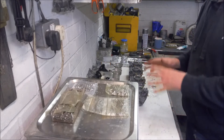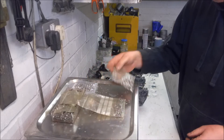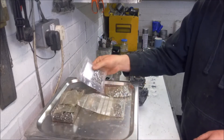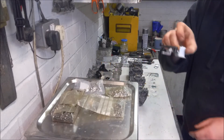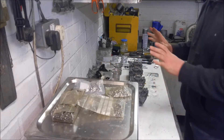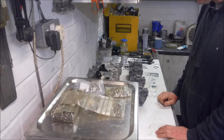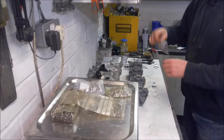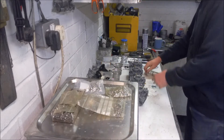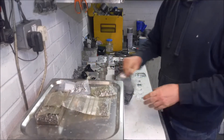I've also splashed out and got myself some nice little stainless Allen bolts - various M4s and a couple of M5s for the rails. When it comes to the rails you really have to use the button head variety rather than a standard cap head, because otherwise they foul with the choke mechanism. I also ordered a carb o-ring set from Blair over at Lytec, so I've got all the necessary o-rings and a bit of red o-ring grease just to lubricate them up.